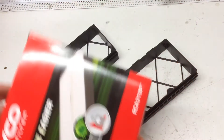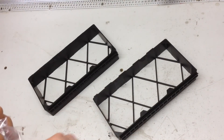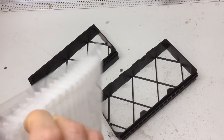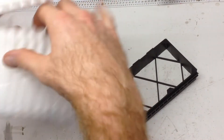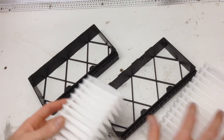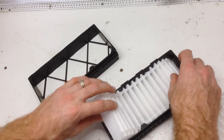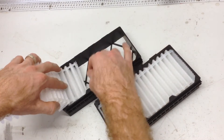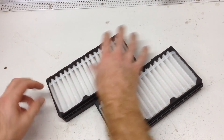So all we're going to do now, guys, is get our Ryco filters. What a difference! Now this, of course, saves us buying brand new Subaru ones, which are quite expensive. Now that we've got the frames, all we do now is buy the inserts. I'll just rip them open like that. And it's just as simple as popping them in the frame — slide them in like this, compress it when you get to the end and pop it in past the corner. And that's in. Do the same for the other element. Really, really simple. And we're done.